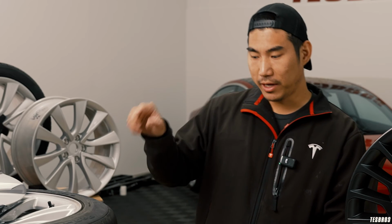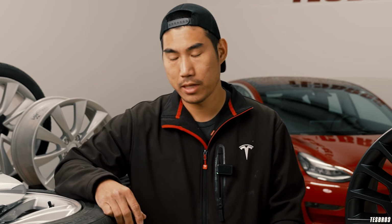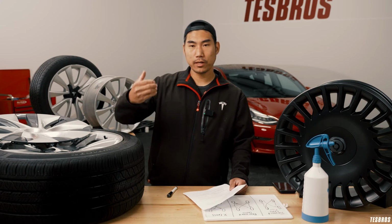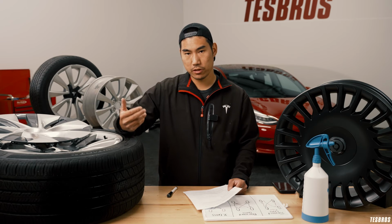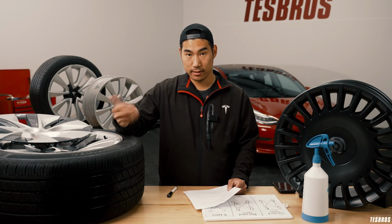All tires, based on the make or the model, are gonna have a rating, right? Some are gonna be like 25,000, with a very low tread depth, and then you've got some that are like 40 or 50,000. That's what I would refer to. Once you reach those, check your tread depth, check that you don't see Lincoln's head, and if you do, then that's when you change it. So that's what I would use rather than changing it every 5-6 years, right?